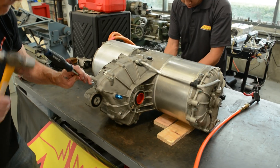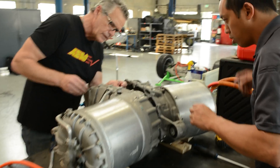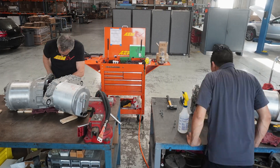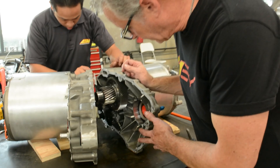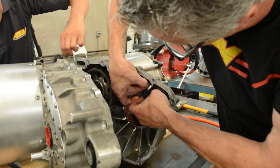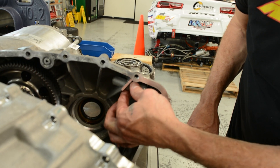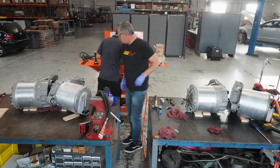So this guy is going to go in there. Let's split this case. Now it's clean-up time. This was modified already, so this has areas that have been machined out. Here's the safety wire that was in here before. I actually machined that case a little bit more to give a little bit more room. Rather than doing just the divot, I actually bored a hole so the filter just sat in it and you didn't have to worry about it walking out into the ring gear. And I ran a little bigger on the wire. This is what's called critical yet mundane — so important. Just keep telling yourself that as you're doing it.